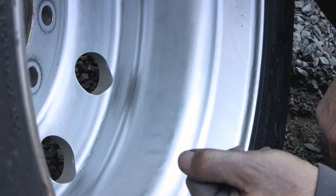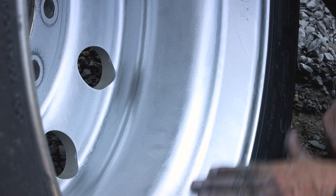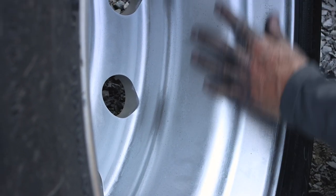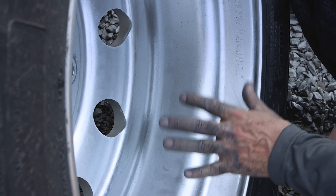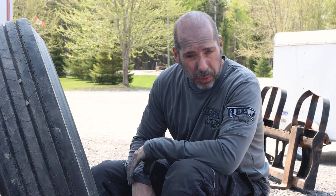We went 320, 400, 600, and 800 — and this is the look you're after. Nice silver, smooth. It's super smooth to the touch. This will be very easy to polish and the quality of the shine that comes out is going to be very good. We are now at the polishing step — this is where the rim comes alive. This is the fun part.